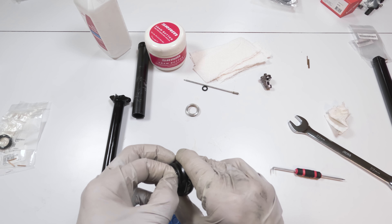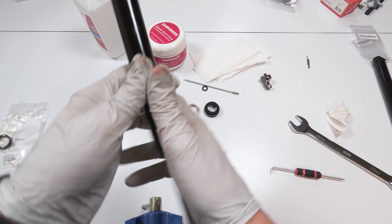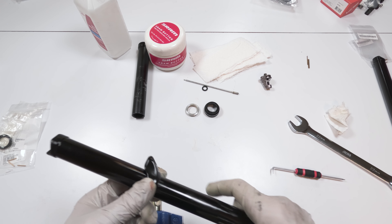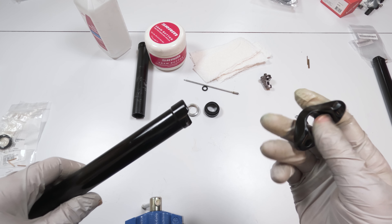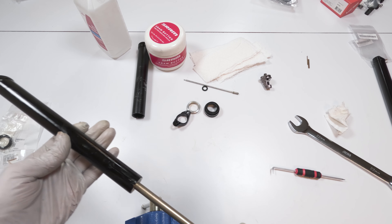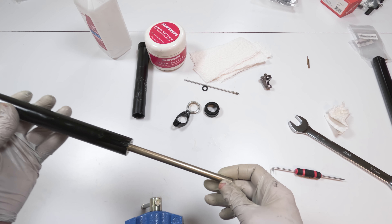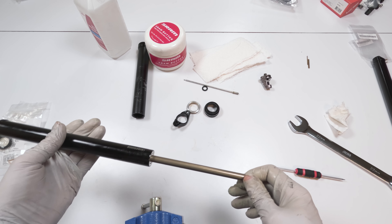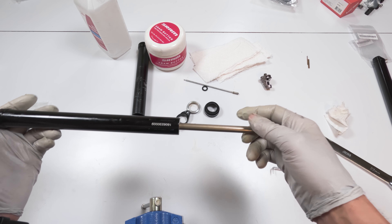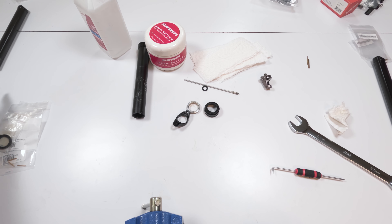We take out the collar. There's a wiper that comes out from this collar — we're going to be changing that wiper. You might also want to take out the seat rail collar. The only reason is if dirt gets inside it, it'll create space and you might get creaking that drives you insane. So this is the old damper. I will be servicing it and opening it up. As you can see there's oil. The oil that came out looked pretty fresh, which is curious. There is play in it — it shouldn't be doing that — so I'm going to swap it out with a new damper.